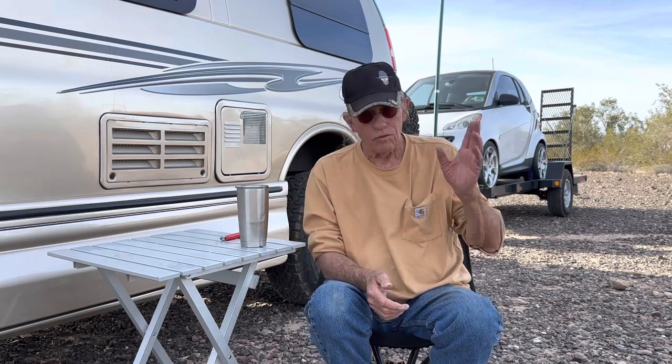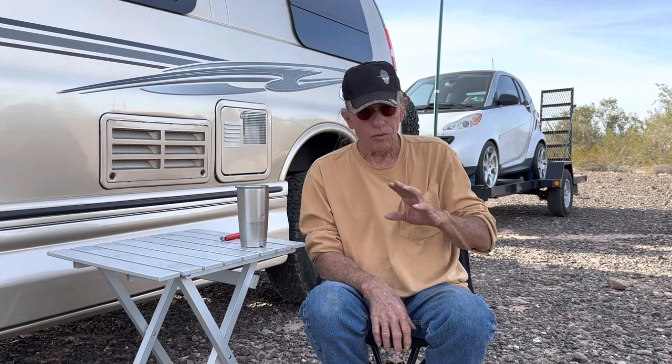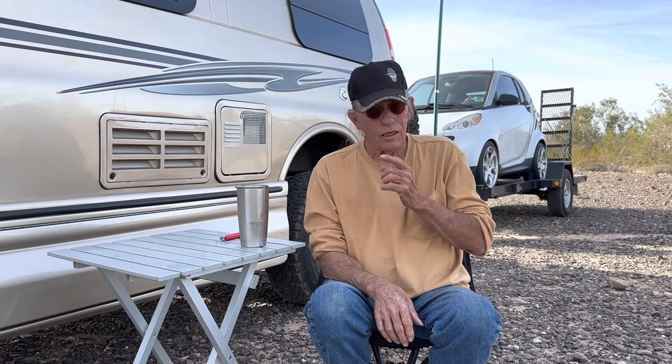In the process, I don't know if I did any good to the chassis battery either, so I got them both replaced. I replaced my coach battery because I killed the old one, and I put a Lifeline one-battery 12-volt 100-amp-hour battery in it. I thought that was an upgrade. Fast forward to November of last year, 2022, when I retired. I ordered my smart car trailer and had to go all the way from Baltimore out to Nebraska to pick it up — it's a custom trailer. I took my Roadtrek completely out of storage, all serviced and ready to go, and I was running on that Lifeline 100-amp-hour AGM battery.